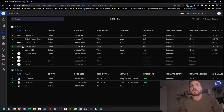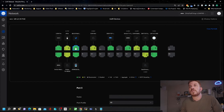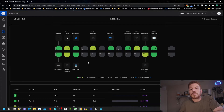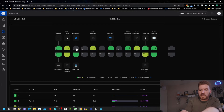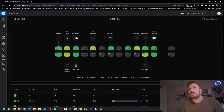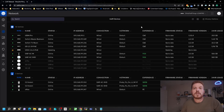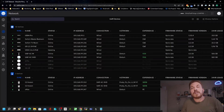It's still not showing up here. We come over to the main switch, over to the ports and port insights, and see it is on port five. Let me unplug it — so that's confirmed, it's on port five. Plug it back in. That just took a long time for it to show up here. Now we'll go ahead and click on adopt. It is adopting, and while we're waiting for it to adopt in the UniFi controller, let me know if there are any other Ubiquiti items you'd like to see me take apart. Now it is updating.